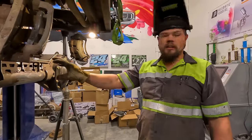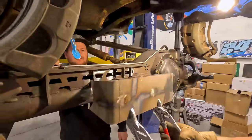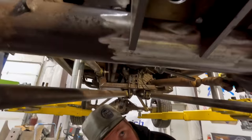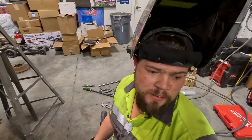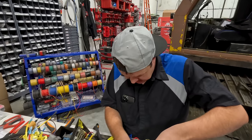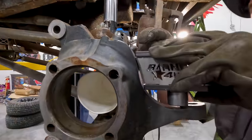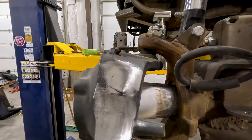Now I'm ready to put that up there. I'm going to pick it up and Colton's going to clamp it. Look at the gap we have — yeah there is a good size gap. Now I'll get it tacked in place. Next step — we've got to get the high steer on because we've got to put the cylinder across it and make sure it's level. I've got to prep this knuckle a little bit more because once we put it where we're going to put it, I didn't go high enough. So I've got to get that all grinded down — probably grind it flat so it sits flush and stays as symmetrical as possible.